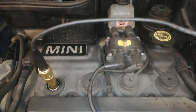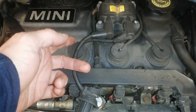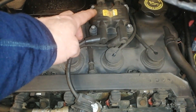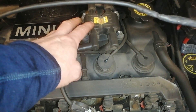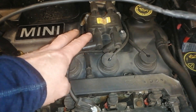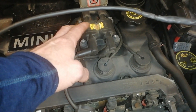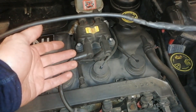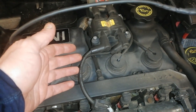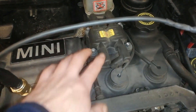The other thing I want to talk about - we have HT leads here as you can see. If you're doing a running compression and you have the spark plug disconnected, this will be live at high voltage. So you want that energy somewhere to go. In the power industry with high voltage breakers, they don't like leaving them with nothing on them - no circuit attached, on no load. They call that stressing the breaker. Same situation applies here - you could stress this coil pack.